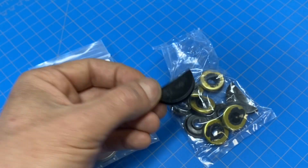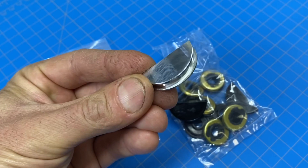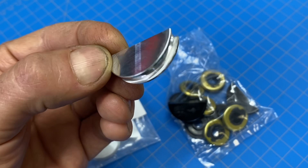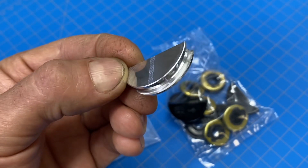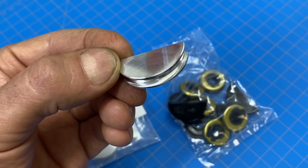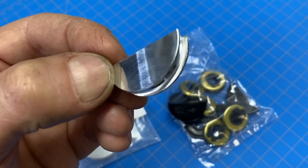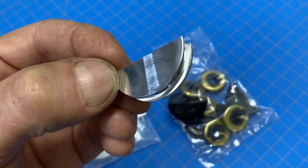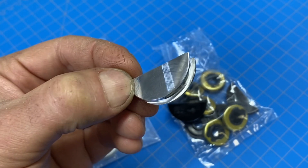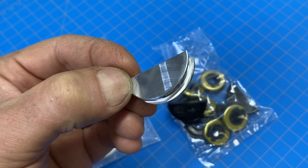That's why I think over time these little plastic wedges are actually a terrible thing to use in your Subaru. That's exactly why I think these billet wedges are actually a better idea for any Subaru — even if you have a non-performance application and you just want a reliable daily driver that's not going to have any valve cover leaks for tens of thousands or hundreds of thousands of miles. You should definitely think about getting these billet aluminum valve cover wedges instead of the plastic ones. These should be used for OEM long-term daily driver builds, as well as high-performance applications.